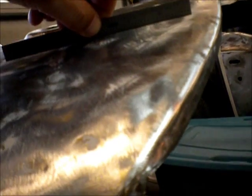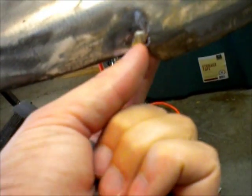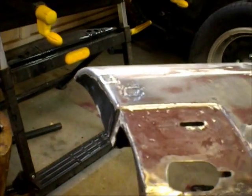I'm going to get back on it and finish up this fender once and for all. I'm going to hammer and dolly all these lumps out — you can see some gaps, lumps, bumps. There's some old brazing work right here I might just melt away and weld, and I'll finish sanding those areas.